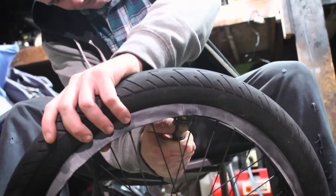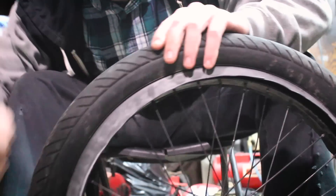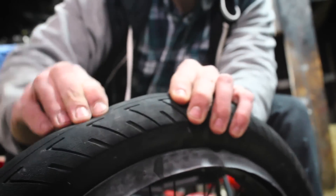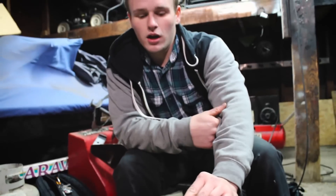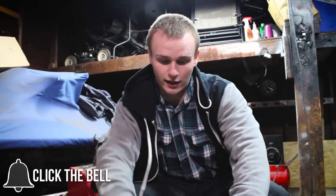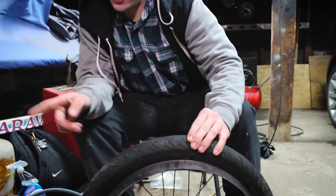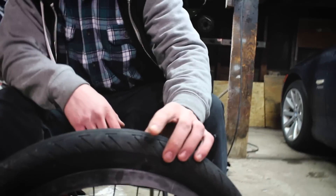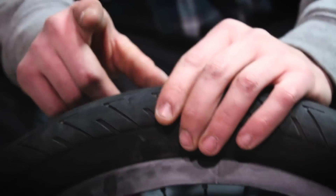The first time I did this, I took a precautionary step to avoid making a mess — you can seat this up and try to seal it dry first. I don't think this tire has many holes or punctures in it, so we're gonna try to seat it without sealant, and if it works, we'll unseat it, put the sealant in, and we're good to go. The tube is just there to seal off the rim and give you a way to put air in your tire. I set my jumper up tubeless without sealant and actually lost pretty much all the air overnight — so the sealant guarantees it's sealed.